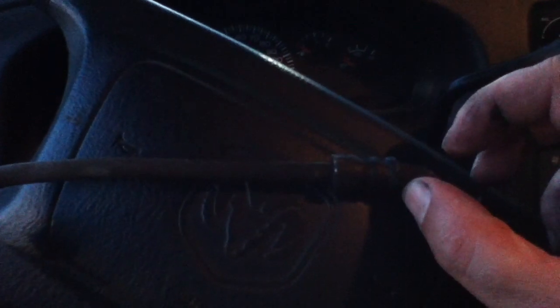Yeah, apparently what goes on when these cables are on their way out is this thing was bad. I'm on another test drive here. But when this thing was all worn down from getting abraded, what happened is when I hit the brake, instead of all that fluid circulating through into the wheel cylinder and helping stop the vehicle, it was bulging and bubbling here. And that's why I was getting a little bit of weird feedback through the anti-lock braking system. And it was getting a little bit soft to braking, because when I hit the pedal, of course, these systems are fairly high pressure, it was bubbling out the weakened part of the hose instead of activating that brake. And it's made a huge difference in the way this thing operates.